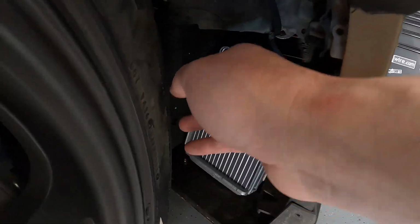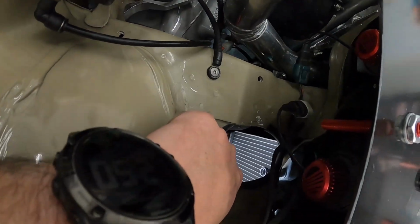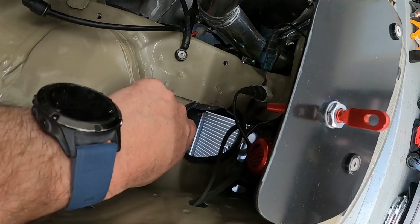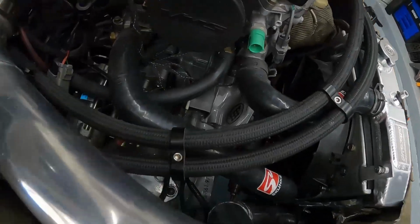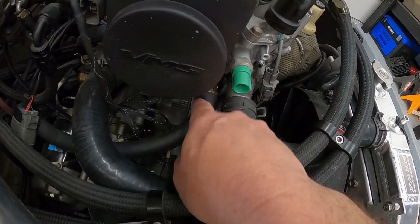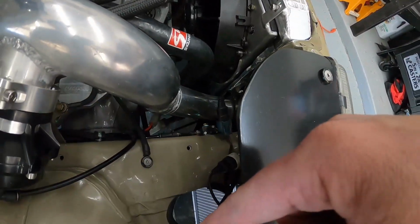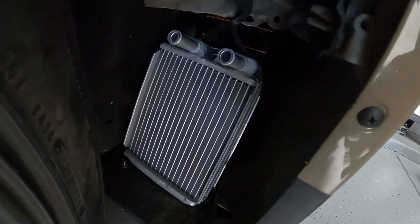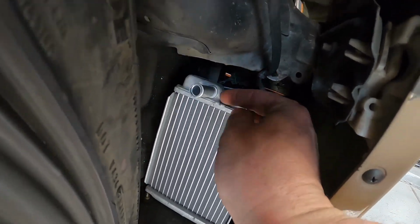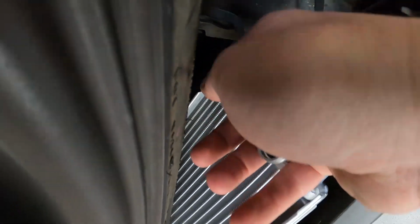And these two coolant tubes, this little hole up here, where my old intercooler piping, my first setup, used to go through, I'm just going to wrap my two heater lines here because I've got no heater, nothing in the car. So I've got my heater line here from the head looped over to the block. This is just going to come here and go straight down, and the one from the block is going to do the same thing. And they will just tie into there, and I will devise some kind of a mount from here to the chassis or something like that. Now